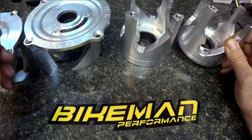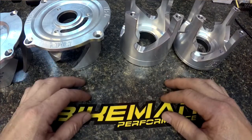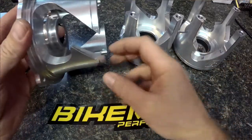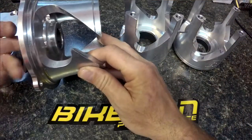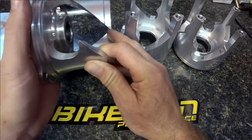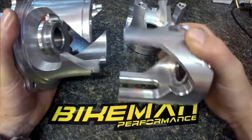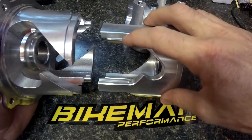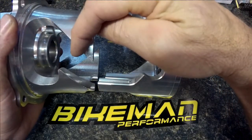Now, you'll see that these two helixes look drastically different, but their functions are relatively the same. Since this helix sits on the inboard side — so this is the outside of your clutch over on this side, and this would be towards the shaft coming in and the transmission — while the Arctic Cat and Skidoo ones come in from the outside. If we look at them that way, the shapes look fairly similar. So when you're in low gear the roller's down here, high gear the roller's up there; and on the other, low gear the roller's up there and it moves to here in high gear.